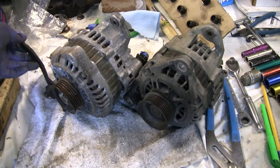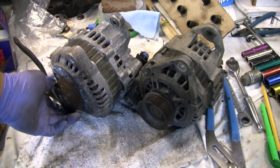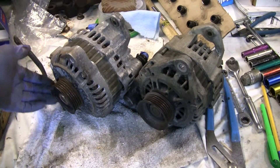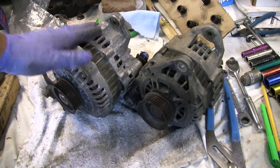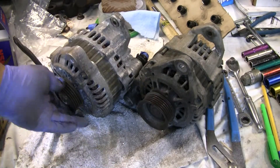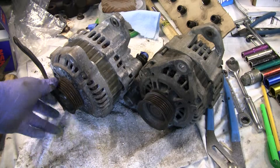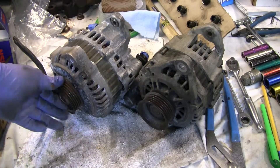Because we've got an adjustment bracket I've actually transferred over already on the other alternator, that we'll be able to adjust how far close or far the alternator will sit in conjunction with the belt. So it'll be plenty tight. It's just the pulley's a little bit bigger. I don't think I need a pulley swap or anything like that. I think it's fine.